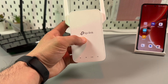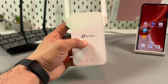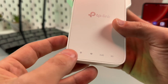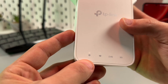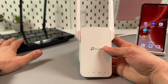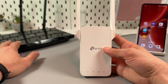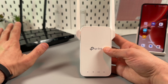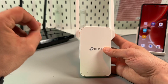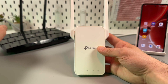Three ways to connect the TP-Link RE315 to your home Wi-Fi network. A quick heads up before you start: you have to make sure that the power indicator on your extender glows solid white light, the router is connected to the internet, it broadcasts Wi-Fi, and the extender is close enough to the router — it's recommended up to 16 feet.